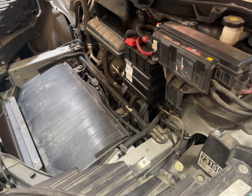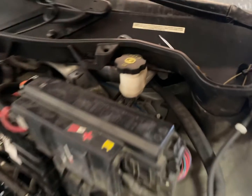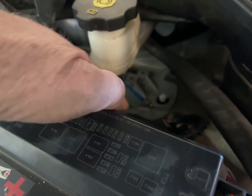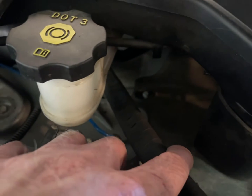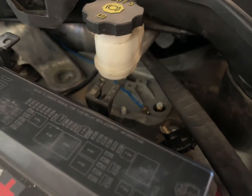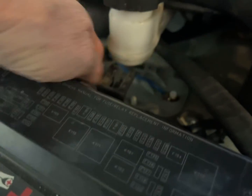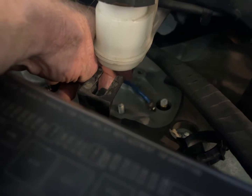I'm switching it out and that is where the air shock connects. You can see there's a screw right there, a screw right there, and a screw underneath the cable right there. They are all 13 millimeter, or at least that's what I used. And then there's the center brass fitting for the air hose right there, and that's 10 millimeters.